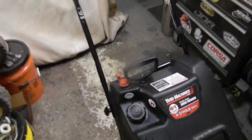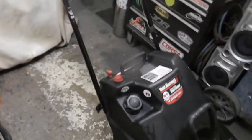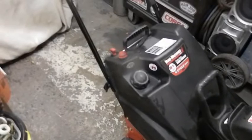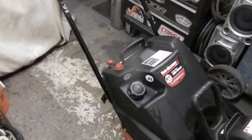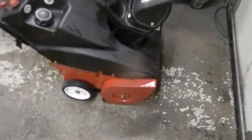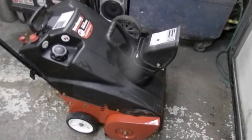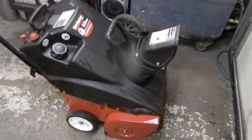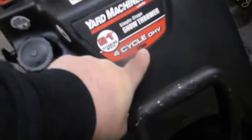So the actual plug was bad - not fouled, just bad. It's a nice little unit and it's 4-cycle, so obviously it runs quieter, the idle's a little nicer and it's a little smoother. Most of it's metal - just a plastic cover on it, as opposed to the one I just parted out which was all plastic. It's definitely not top of the line. Junior's looking it up - it says on here 123cc, so I've got a feeling it's going to be somewhere in the three horsepower zone. It's a lean-back motor with an overhead valve engine.